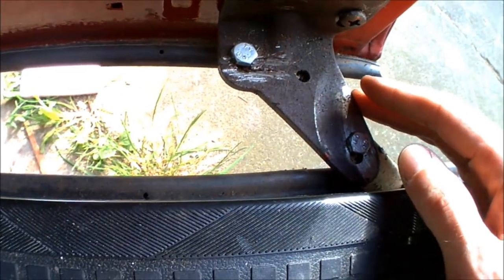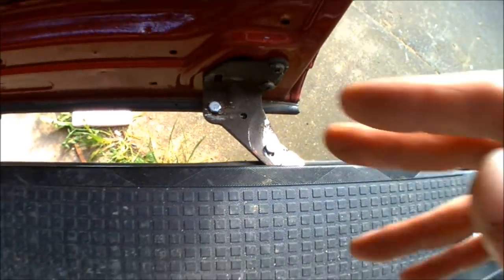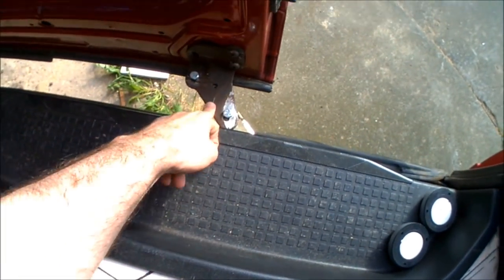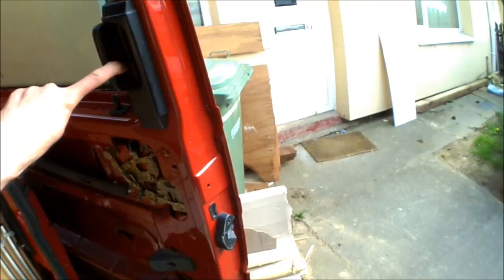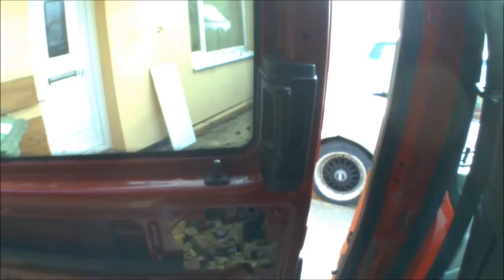On the front side, at the very bottom, we've got the arm runner. Connected to the arm runner inside is your main roller — so if you've got a bit of a sticky door, you need to replace the roller. I'd say this door moves nice and freely because I've already changed the roller on this, so literally one finger and this slides around — it slides really smoothly.